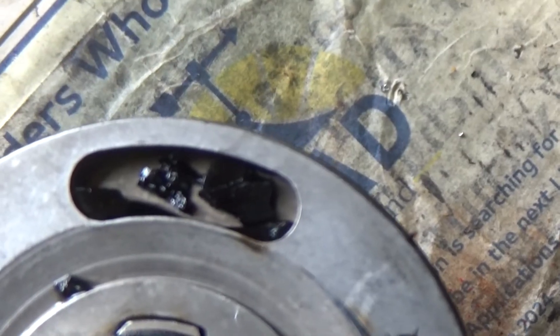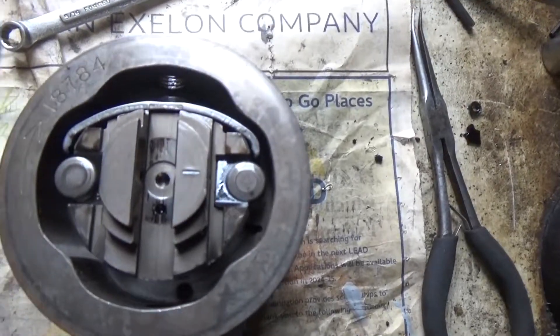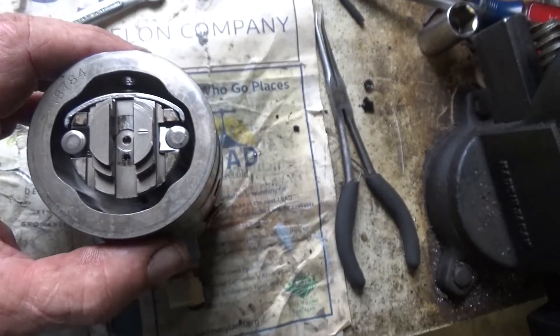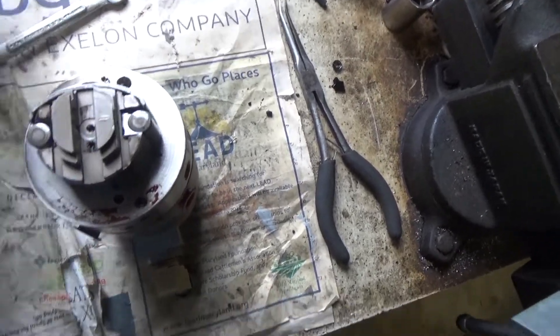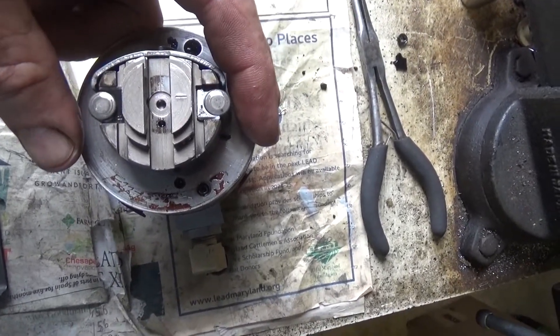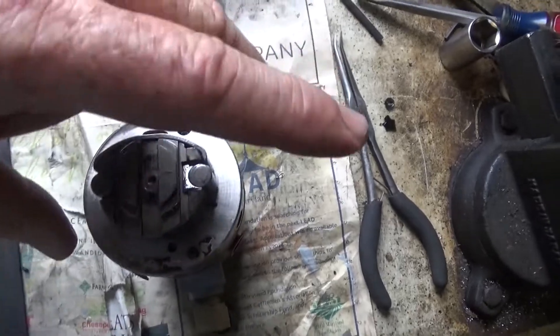You can see more pieces of that decomposed governor ring. Yeah, you can see plenty of pieces of debris inside there. I'm sure most of you know how these pumps work — maybe one or two of you don't. This is your cam ring here — it's got these bumps on it, and this rotates. It's got these rollers; they will slide out, and then when it hits this area it pushes them both in.